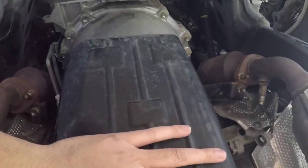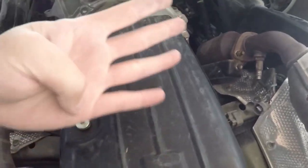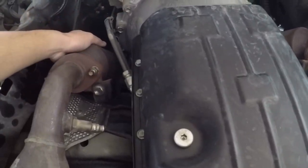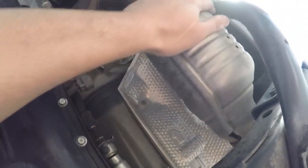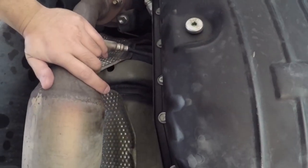I'm laying under the truck to give a better angle. So this truck has a total of four catalytic converters. If you look at the top, the headers have the primary cats which are these two. And then the secondary cats are within this mid-pipe section, and the Y-pipe is going to replace these two secondary cats.